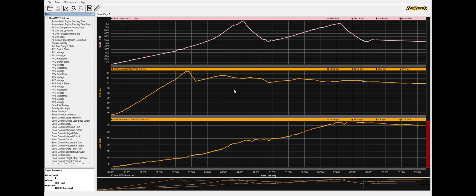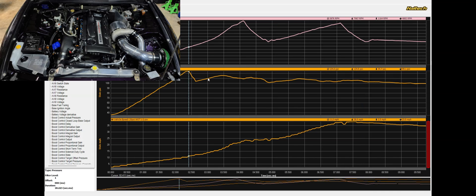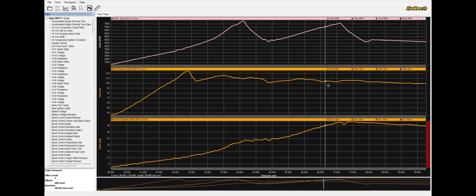This will be our final example — the upgraded pan that every other car has had, with good oil pressure, except this one has a billet PRP oil pump with base pressure set to around 120 PSI. And as you can see, even though we have this ridiculously large oil pump, we're still able to maintain over 100 PSI of oil pressure through this first and second gear pull. This engine, along with the rest that had the oil pan modification, simply will not have any oil starvation issues unless you do something silly like not fill it up all the way.